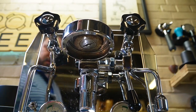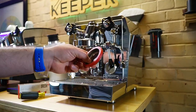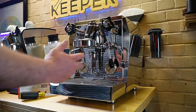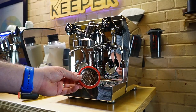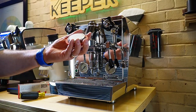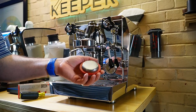It's really not that dirty, despite how much I use it. Now that we have that taken off, you can see the silicone gasket. I do recommend, even on a new machine, putting a silicone gasket on — it just glides into place so much easier. Some people say their rubber gaskets crack; I've never had one wear out on me yet. I think they're more of a problem on machines like the Gaggia Classic Pro. On this machine I used it for years before upgrading to silicone, and it's well worth the $8 investment.